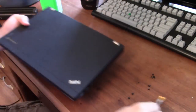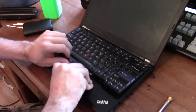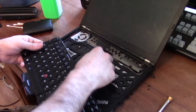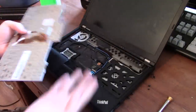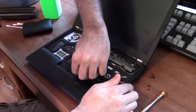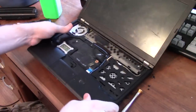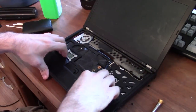Once you've done that, we want to remove the palm rest and the keyboard. It should be pretty easy — basically you just push the keyboard forward and it will come out of its socket. It is attached by a little ribbon, and you want to peel it open. It's not attached in any fancy way, it just sort of plugs in. For the ribbon down here, there's a little black latch — you want to make it go up. You might need a credit card or something like that to force it. Once you force that little black latch up, you can freely withdraw the ribbon and take everything off.